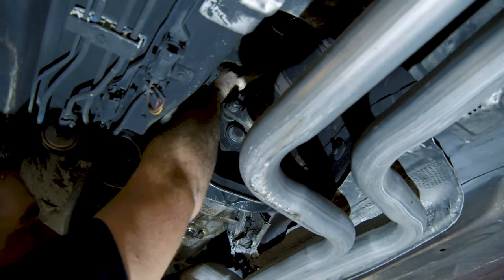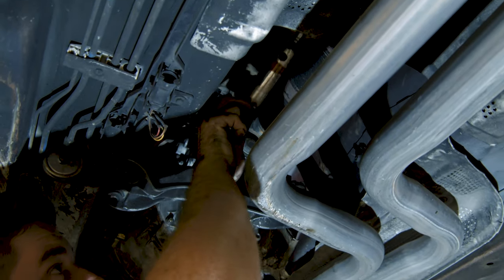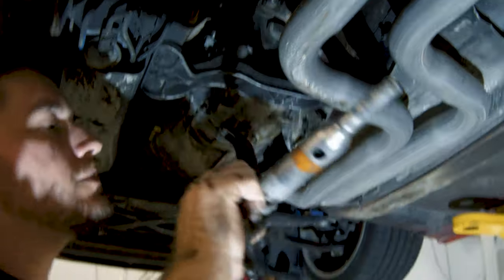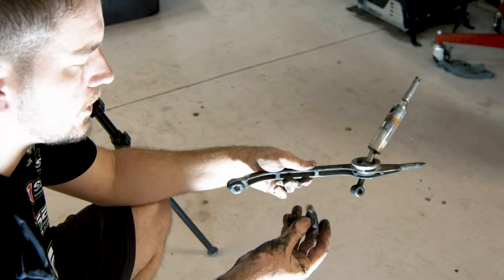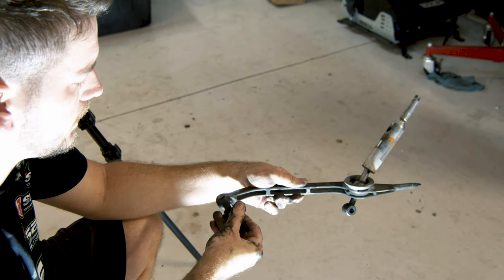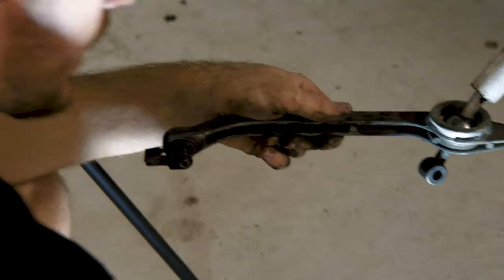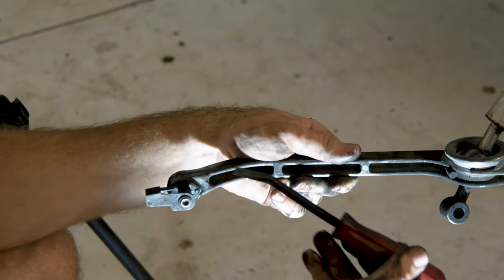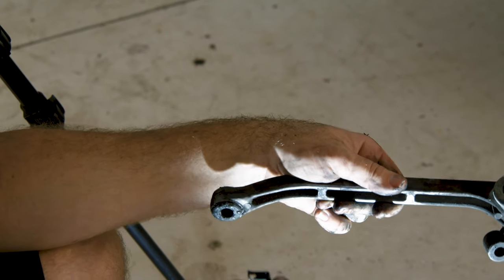With this shifter arm, the linkage at the front is going to be this pin — it's collapsed onto the top of the transmission. You have to get a flathead or a pick underneath this clip so you can pry it up and swing it, and then you can pull it out from the side. Now that we're done from the underside with removing linkages, we'll go back up top and start the holes for the IRP shifter.